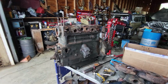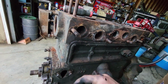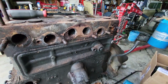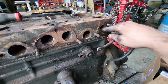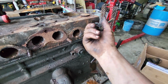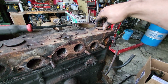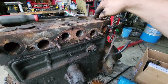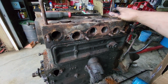Alrighty, had to make myself do it. Pulled the exhaust manifold off. Surprisingly, we only got 2 broken studs. It's the exhaust manifold studs that break, of course. You can see this backmost cylinder, the one that got all the water in it, has all this fun, colorful stuff in the exhaust port. So hopefully the port and the valve and everything, well, the valve's not broken, nothing looks wrong with the valve. I think this old girl will come back around here.